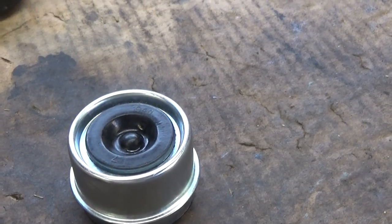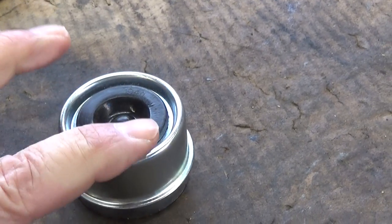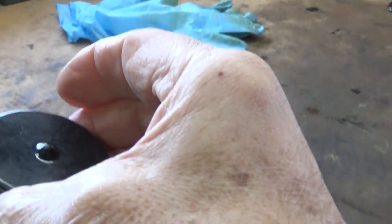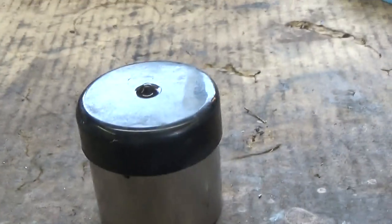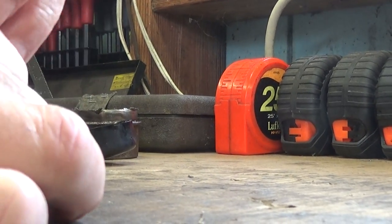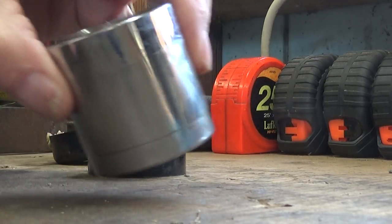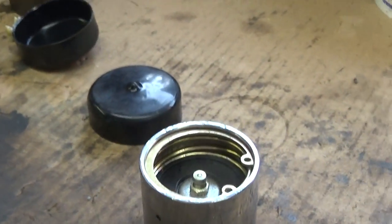It's an ingenious setup. It's a little bit different than the bearing buddy. The bearing buddy — I'll show you what it does. I have the one that's on there, and they also have the other side that I was going to put on. Let me get this cap off and I'll show you how these bearing buddies work. These are a very good way of lubricating your bearings if you do not have the setup like I have with the hollow axle stub.